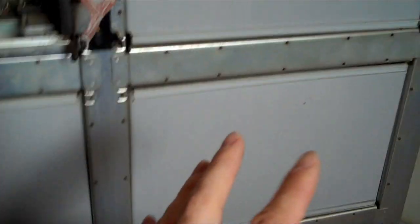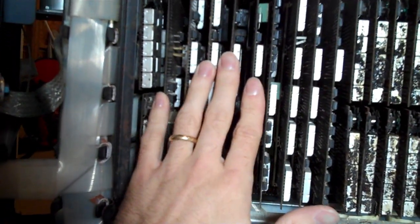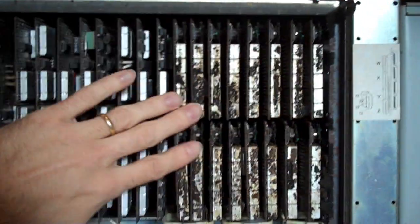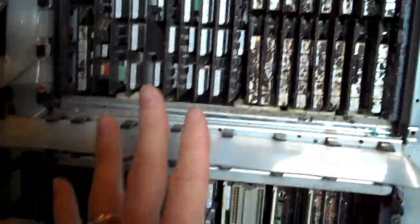Usually most of this logic area is empty. If you have a modem — and there are several modems this comes with — or the MICR, which is a magnetic character reader, that would go in here. At the moment this has got nothing, so the blower fan just cycles through empty slots. The A1 module, which is this top module here, contains the processor and the RAM. These six boards are the control store — the RAM boards for the control store. This is the I/O processor for the system. This is the main store — the processor that actually handles executing the applications off disk. This is the RAM for the main store. The base system came with 48k, a well-stacked system came with 128k, and this is 256k, which is why it needs the extra supply. So this is completely stacked out, which is really exciting.